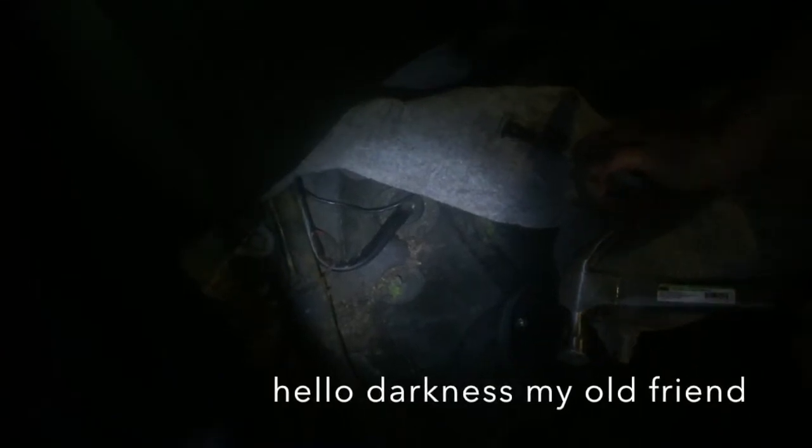You just saw the lag bolt trick from the bottom, so that's going to be in that sleeve where this would normally go down into. I'm not going to put it in there because it'll fall in, because we got the subframe down a little. But that'll be in there and it'll be sticking up. You'll take a hammer from the other side of the car and come in and hit this thing as hard as you freaking can. Just swing at this and it'll get that rust ring and it'll pop down and the subframe will be hanging down. So that trick worked.